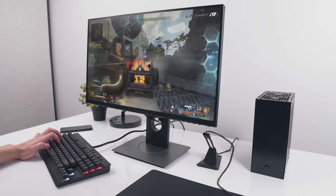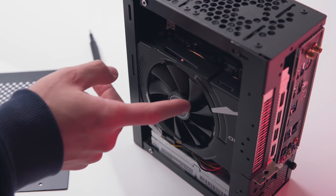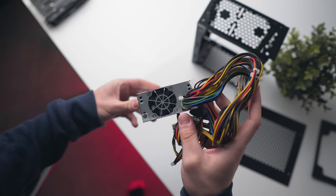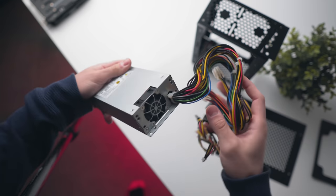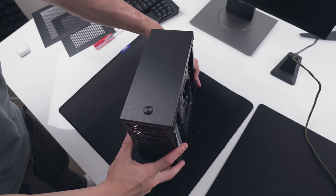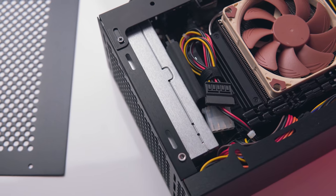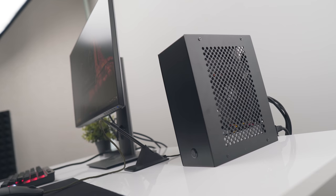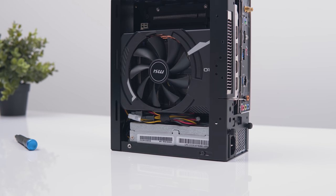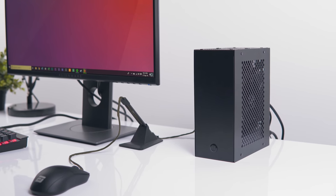Beyond this insanely fun build though, there was one big problem. That ridiculously high noise, believe it or not, is not coming from the CPU, GPU, or the top fans, but instead the power supply. The Flex ATX unit uses a 40mm fan to provide airflow to the circuitry, and despite being well under the output limit, this thing gets unbearably loud when it's under a gaming load. I initially thought this was due to my cable management, since bunching the cables in front of the power supply kind of blocks the fan — but oddly enough, even when removing the cables away from the power supply fan, it still gets pretty loud. So that's definitely a problem, and I think the only solution would be to swap that fan to a lower noise option from Noctua. The power supply itself didn't seem to be getting that hot, so a simple fan swap would work quite well here and wouldn't be too hard to do.